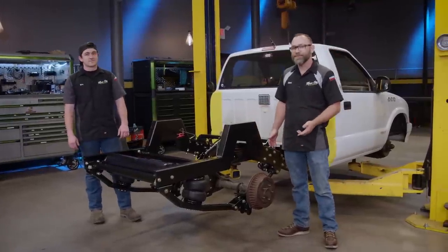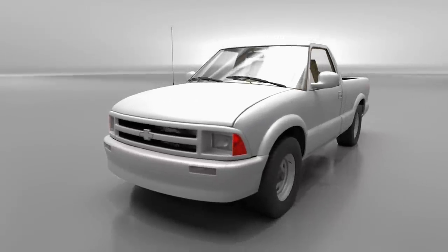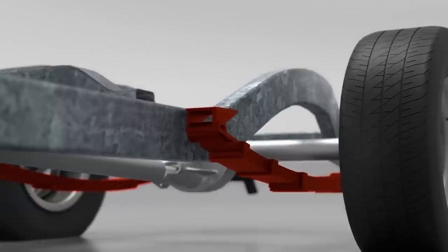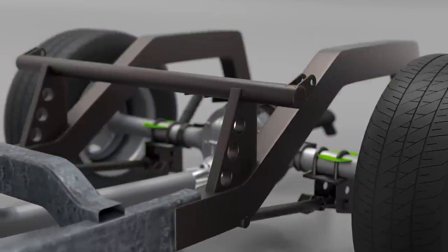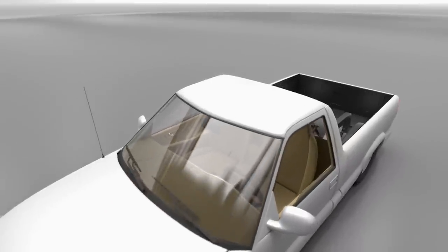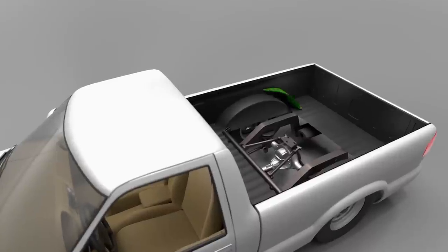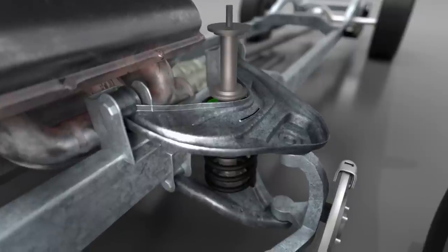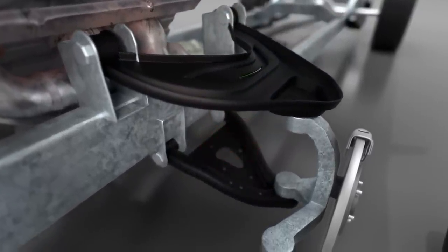If you're just joining us, we've got big plans for this build. We started with our S10 in completely stock form with its coil spring independent front suspension and leaf springs in the back. We ditched the leaf spring setup to install a full back half bolt-on five-link kit. We made room for the new frame by sectioning the bed, allowing the notch and the axle to tuck up between the inner wheel tubs. Then we boxed it all in.